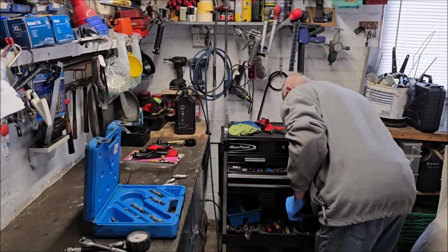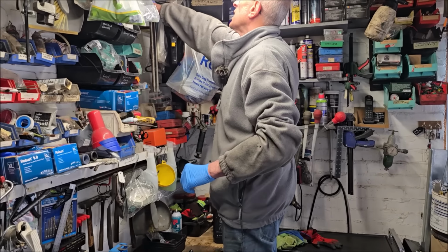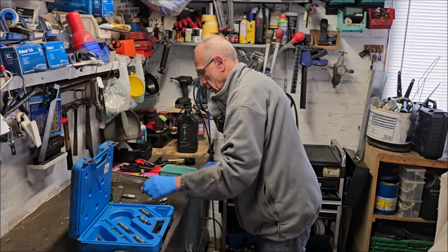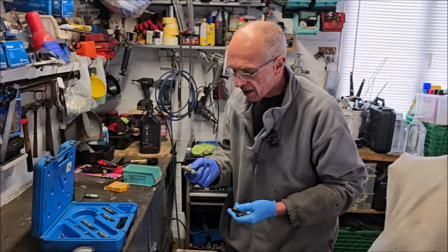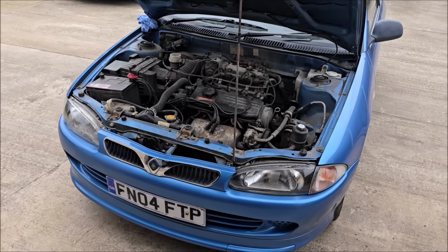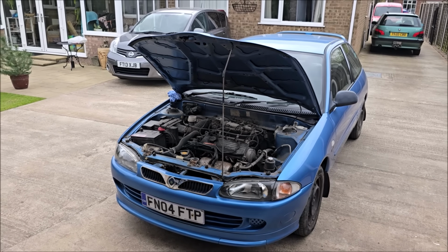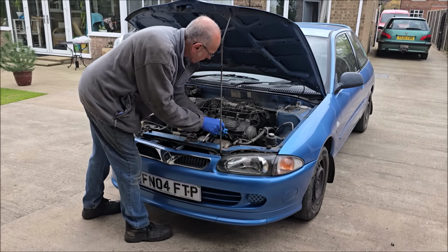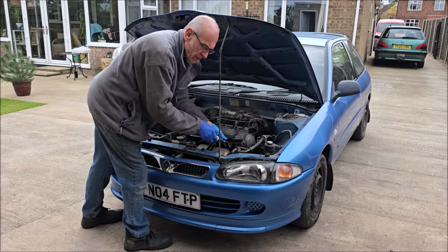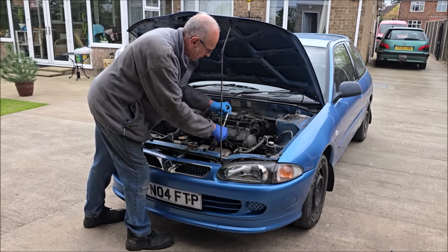You're going to try something. Just in case it's misfired that much, it's washed the bores. Washed the bores? Does that make any sense to you? It does. You've got some spark plugs in stock, have you? It's a slightly different heat range, but washing the bores means all the fuel has washed the oil from the bores and caused it to have low compression, especially being shunted around on choke. If you imagine, son, if you've washed all the oil off the bores, the piston rings aren't going to seal very well. Yeah, that makes sense.